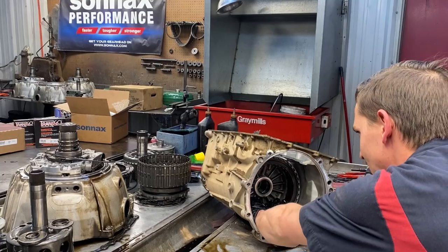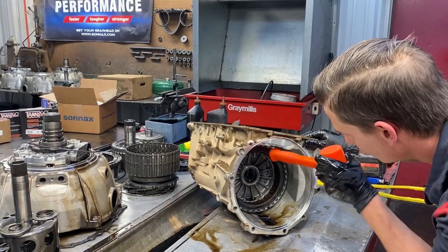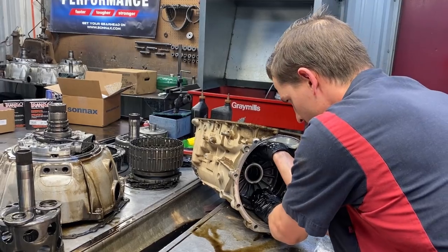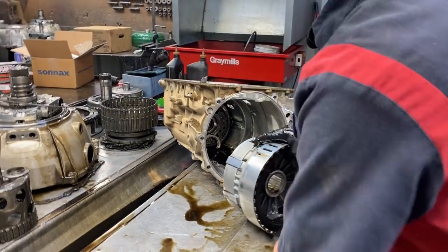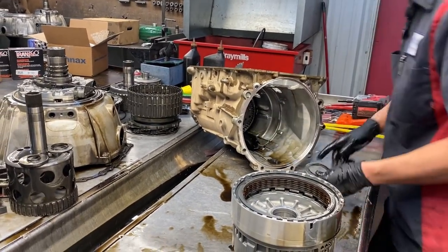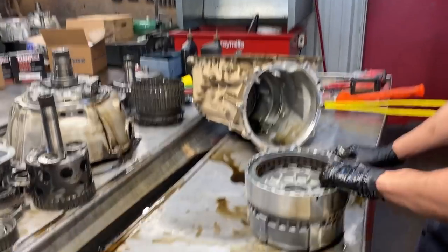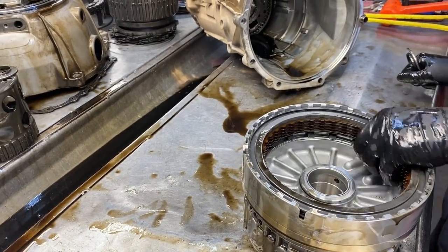Let's grab our support. Some of these you have issues with, some come right out. I'm telling you guys - when you drop it down into the board going back in, it's heavy. You can't pick it up out of there once it's in. So we've got our two-six clutch on top and on the bottom we have our low reverse clutch.